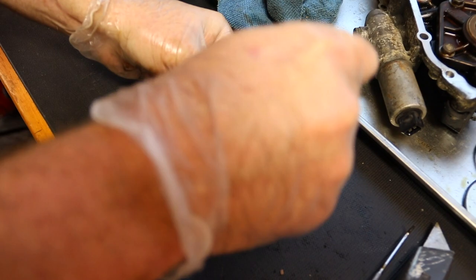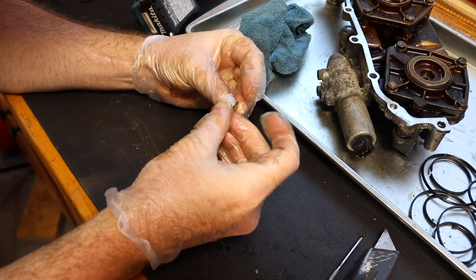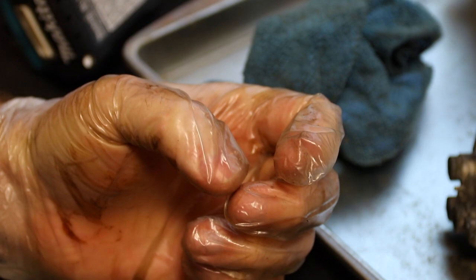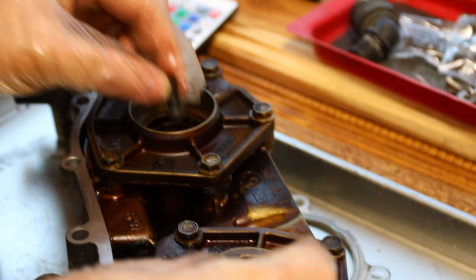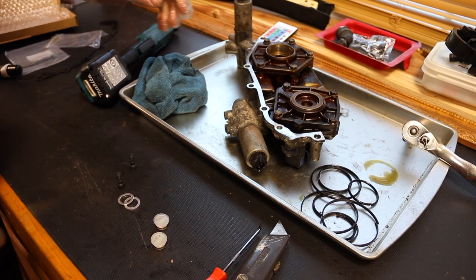Next up are these. We have the old ones of these over there on the cart, so we have new ones. All we're going to do is slip in that like so. Another one like this. And these little seal caps, after you put these bolts in here to screw the centers to the cams, which are reverse thread, then you pop these little things in, and then you put the big screw caps in the end, and you're done. Overall, not bad.